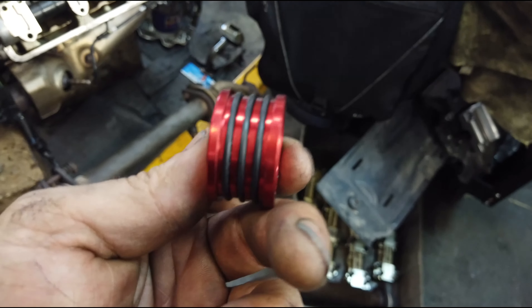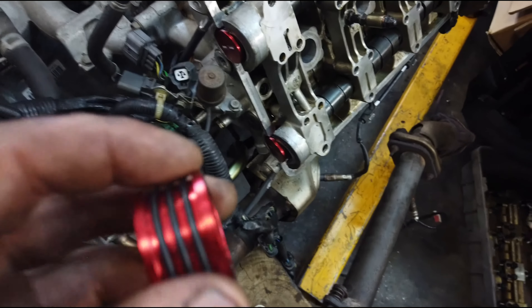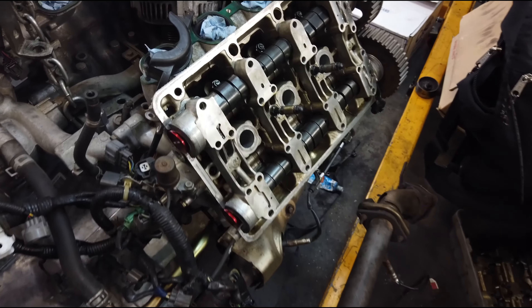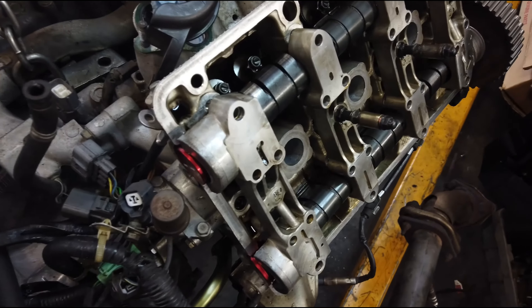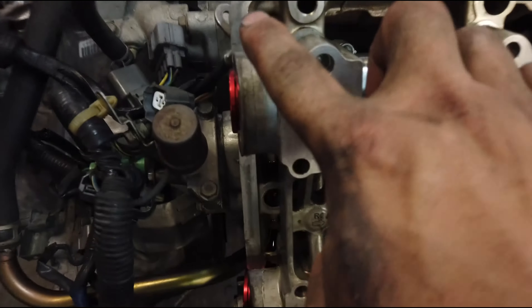I got these nice cam plug seals, three o-rings. Now apparently you still have to use liquid gasket when you put them in, but you're going to use such a thin amount. Everywhere you use liquid gasket on this, you're using such a thin amount that you're not trying to make a seal — basically trying to keep the rubber in place, kind of like a paste, so it doesn't fall out. Once you put it on very thin...